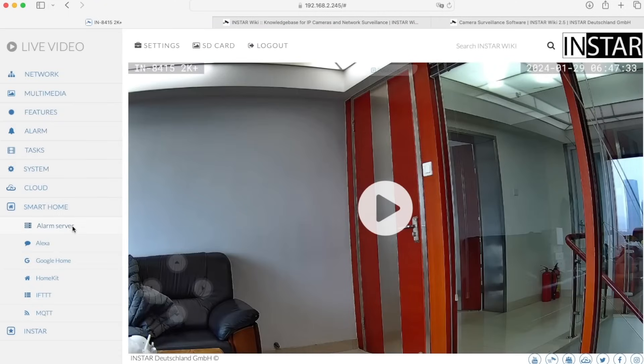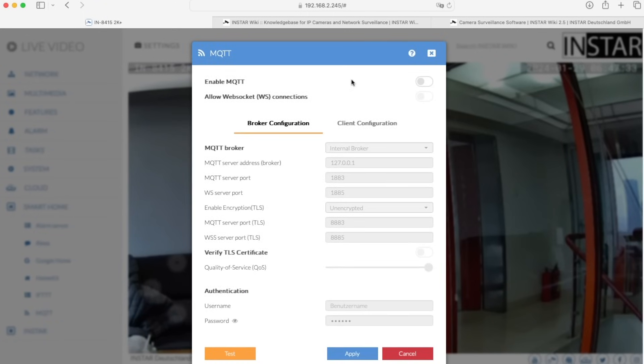If you simply want to communicate locally with the camera, we recommend using MQTT. The camera supports MQTT version 5, has a broker integrated, and can also be used as a client. Commands can also be sent over WebSocket. MQTT allows you to integrate the camera and control it — typically you integrate the video stream via RTSP into your smart home interface, and for commands like activating or deactivating the alarm you use MQTT. The advantage is that you will always have the up-to-date state: for example, if I deactivate the alarm in the web UI or app, this will reflect right away in my smart home.